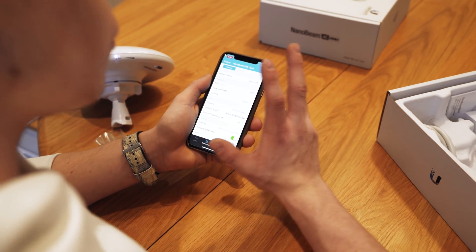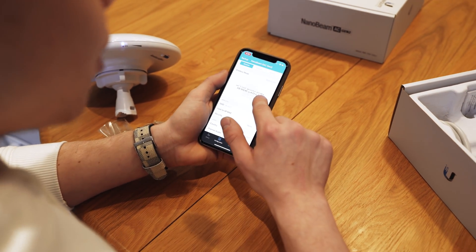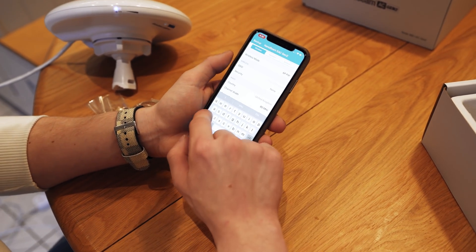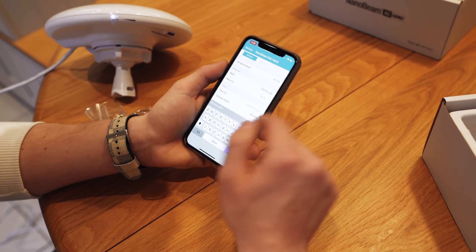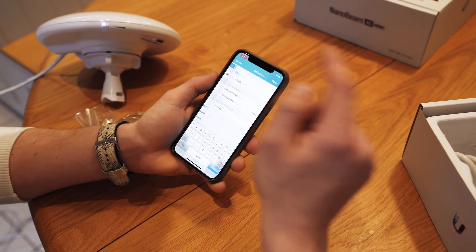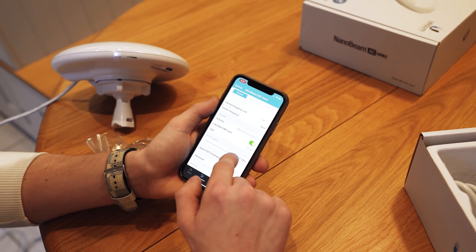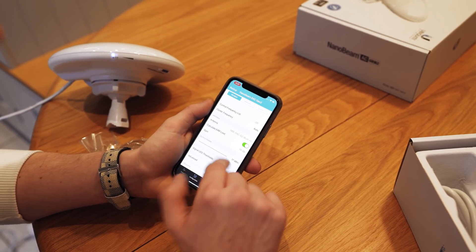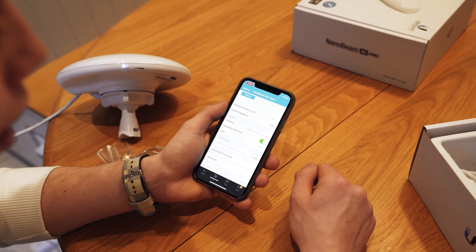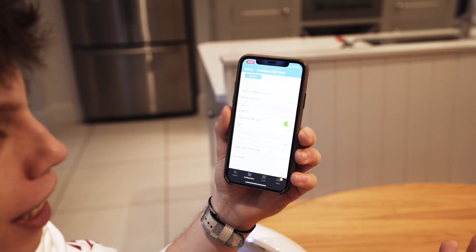I'm going to show you how to quickly configure these radios. For wireless mode on our master, we want to change this to access point point to point. We're going to change the SSID to TECHFLOW, all caps. We'll give it security — WPA2 — and I'm going to put 12345678, but I suggest you do it more securely. Going to put the channel width down to 20 megahertz and then adjust the power of the radio. 17 dBm is the maximum power. This is dependent on how far the radios will be apart. Since these radios are only going from my house to my garden shed, I can turn the power down — I've turned it all the way down to 5 dBm. Now I'm ready to save these changes.